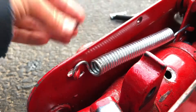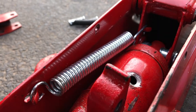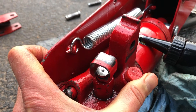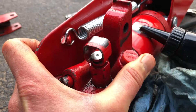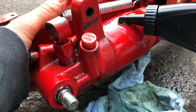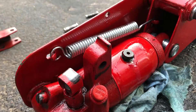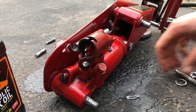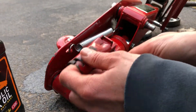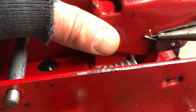This little piece is the cap. We'll take our jack oil — link in the description below — and fill it until we can see the entire cylinder is full. Then reassemble the jack just as we disassembled it. Put this piece back on with its two pins — pin one, then pin number two comes through here to guide the straight part through, and clips right into place.